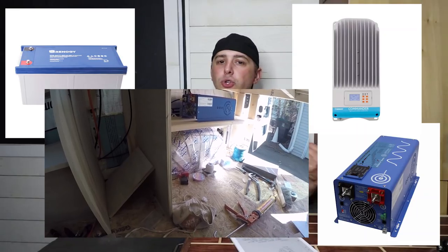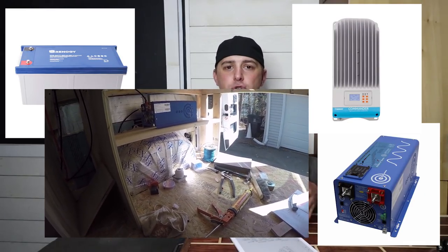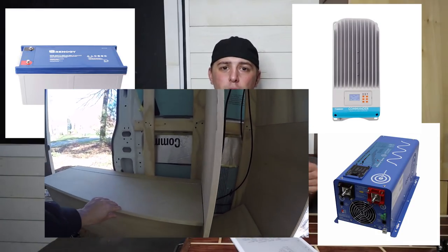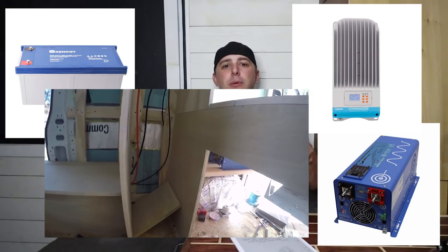I knew I wanted a slide-out table, so I didn't know how I was going to do it — I just knew that I wanted it there, and eventually when we got to that point of the build, you figure everything out. I knew I wanted the closet. I wanted to almost have my bed separate from the rest of my area. I knew I wanted the batteries, the charge controller, and the inverter. These are all big items, and I needed to stage them properly in the van so all the wires run properly. I needed to keep electrical on one side and water on the other.